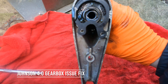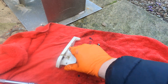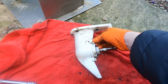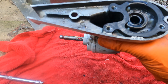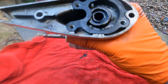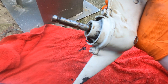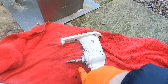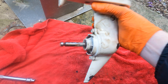While doing the impeller it seems the drive shaft came out — doesn't seem to be retained or anything. So without forcing it back in I just want to take off this front cover and see what's going on inside this gearbox, because it's also leaking oil. There might be a busted seal. We may have to pressure test the lower unit as well. We're going to take off the prop shaft cover where the oil seal is — that's where the drive shaft goes in.